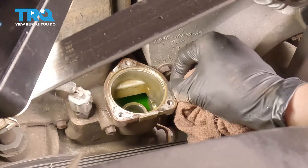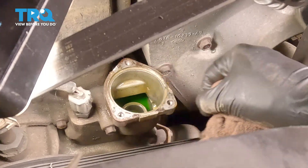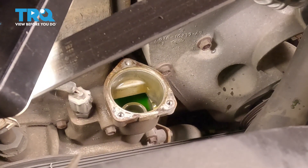There is a little bit of corrosion around here, and it looks like someone also put some sealant, which isn't supposed to be there — the gasket is supposed to do the sealing. So I'm going to take a razor blade and clean all this up so the housing can mount properly, and then we'll get it back together.